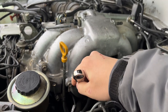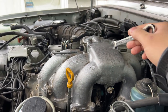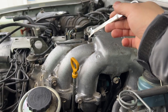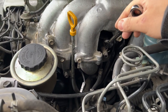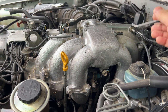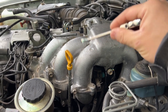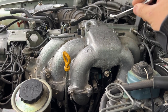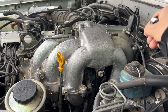I highly recommend that if you want to do the EGR delete, do it when you have a reason to remove your intake plenum. Because if you're going to remove all of this, it's a good time to replace your gaskets, clean your throttle body, degrease the inside of your intake plenum, and maybe even rebuild your fuel injectors. Once you remove the intake plenum, you'll also have access to your fuel filter. For this case I'm going to remove the plenum, clean the throttle body with brake cleaner, and put in new gaskets.